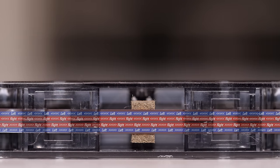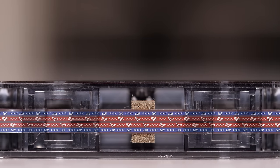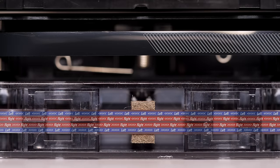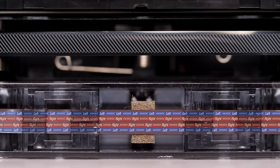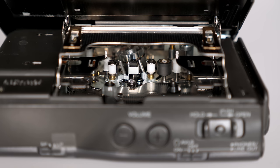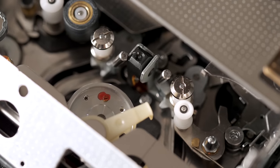Most tape formats broke audio into channels and wrote it in a linear fashion down the length of the tape. The heads were stationary and simply picked up or recorded audio as the tape slid past, creating a direct correlation between tape speed and audio quality. DAT did things differently — the audio was written to the tape in diagonal segments, which was a much more efficient use of tape surface area and allowed them to lower the tape speed. The mechanism inside a DAT deck is based on how video cassettes work — the head is cylindrical and spun around at an angle, so every rotation completed what was called a helical scan of the tape.